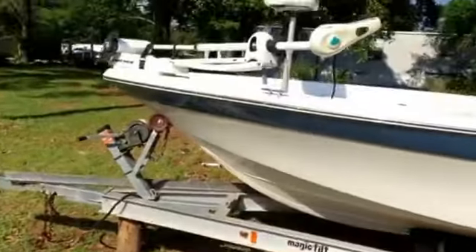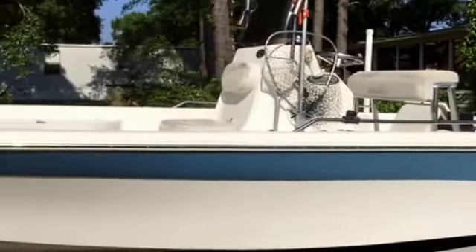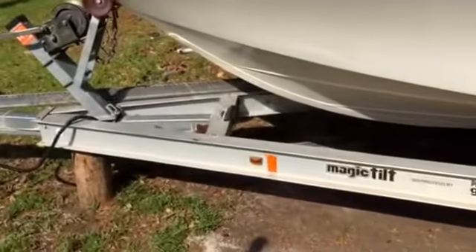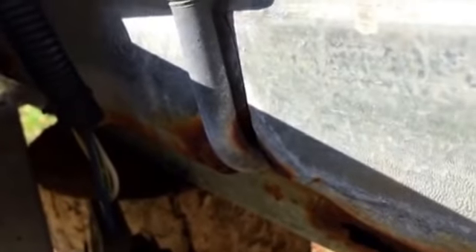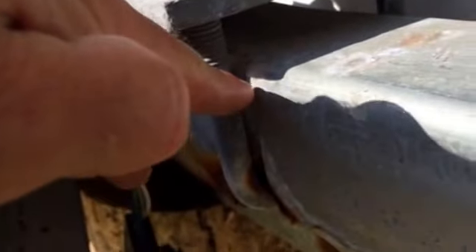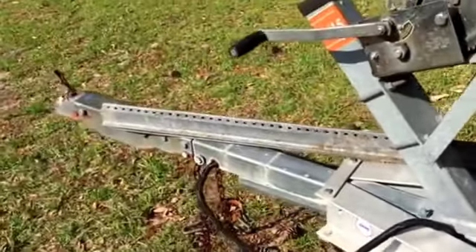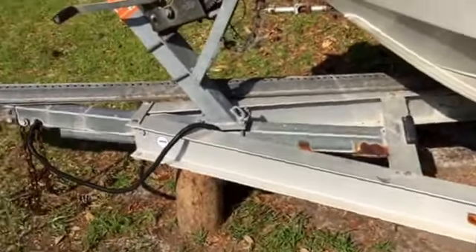This is the 2110 Nautic Star I'm going to be putting on it. The axles are slammed. See this nice big crack here, extending all the way up. All of this is rusted out down here on this tube, and that's what did her in. So I've got a piece of metal there - I'm gonna try to strap it and get it to the boat ramp and swap them off.